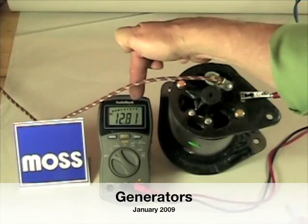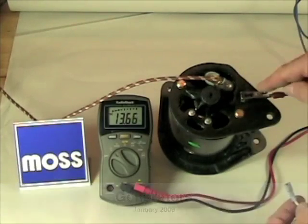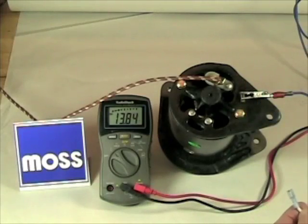When you've done that, watch your voltmeter. If the voltage begins to climb, this generator is working — and this one here is testing out just fine. If it refuses to climb even after you put power directly to the field, the generator needs service.